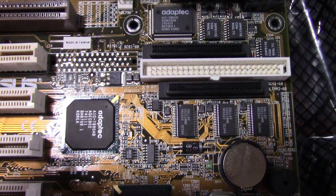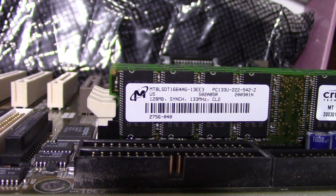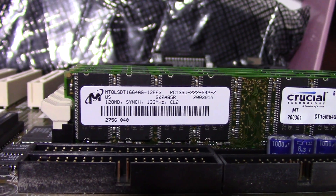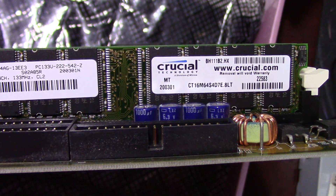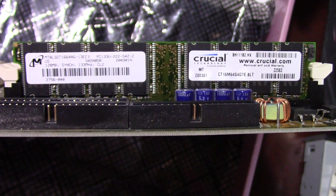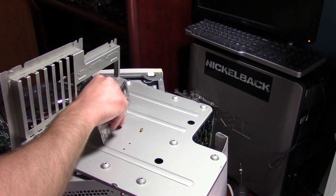The seller shipped this board with 512 megabytes of PC-133 CAS latency 2 memory, which is as good as you can get for SDRAM at this speed. A pair of Coppermine slot-1 processors running at one gigahertz each with a bus speed of 133 megahertz.